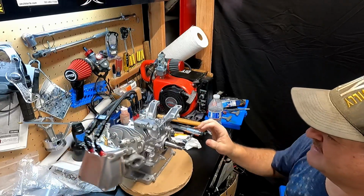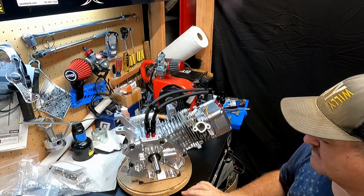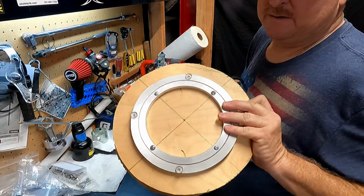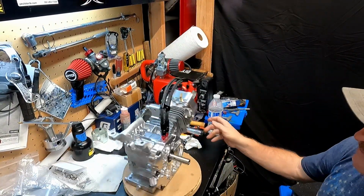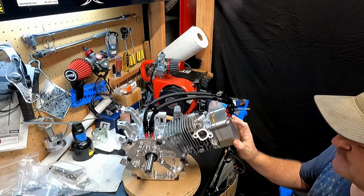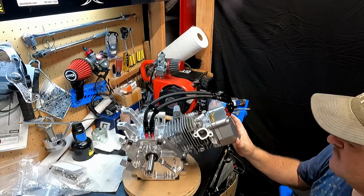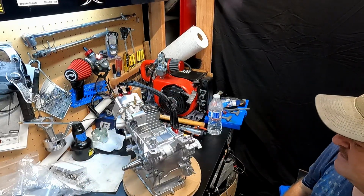I like that. I built this swivel base yesterday. I had this piece of plywood laying around. Then I put some cardboard on top just to catch the dirt and oils. And then I bought a bearing on the bottom that it screws to. It had some bad reviews. People said it wouldn't spin, but I found when it was screwed into the plywood, it wouldn't spin also. So all I did was put a little washer underneath between the wood and the bearings, and it spins perfect. I'm very happy with it. So a little spinning turntable for my projects makes it easier to work on rather than trying to muscle it around all the time.